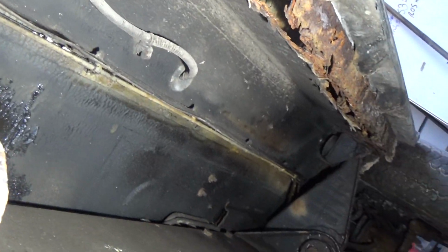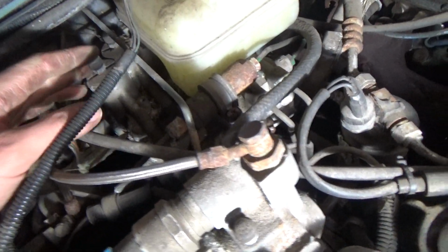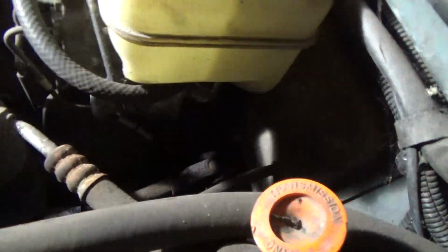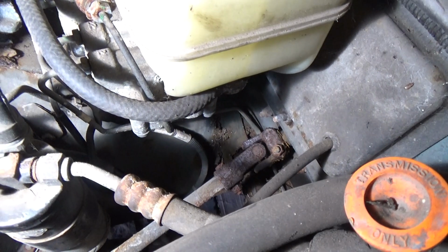So I'm going to head down the length of the vehicle. Our brake lines are going across there to the front. So coming down to the front of the vehicle now, still got the two lines across here, and again we come into a rather wet and oily patch again. So this is where it's been leaking, and then it obviously goes under here and then up there. So this is our ABS system here. Got the brake master cylinder there, and the ABS pump, which is here, and the 2 pipes that we're most concerned about are the 2 on the most inaccessible side of the block, which are down there, and they come out the front actually.